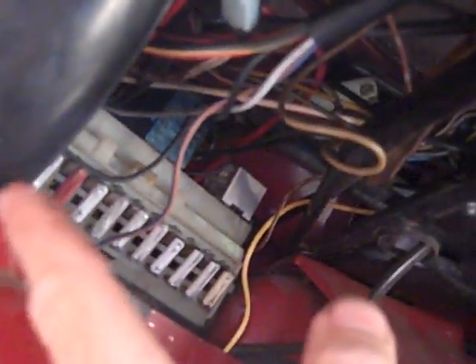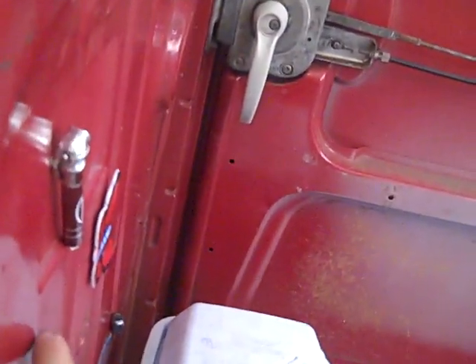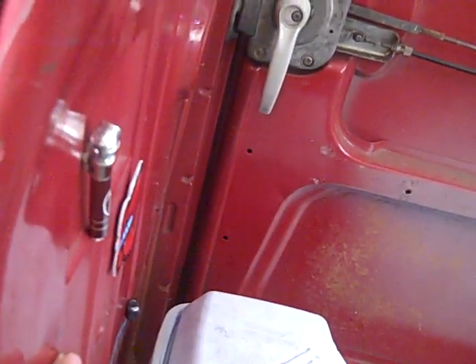The initial problem I had when I got the bus was that I couldn't crank it all the time, and then I started blowing a fuse. I looked at number two, figured out what it was, ran down all the wires, couldn't figure anything out. I finally pulled the fuse panel itself out and found a straight blue wire — realized it didn't go anywhere. Since I have the camp mobile it goes to the sink; it's just logical — blue for water, for the little pump. The wire was still just sticking out of a hole, so if I stopped abruptly the wire would come and make contact and short out.